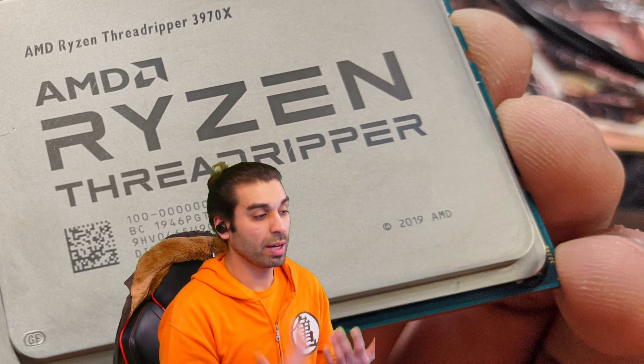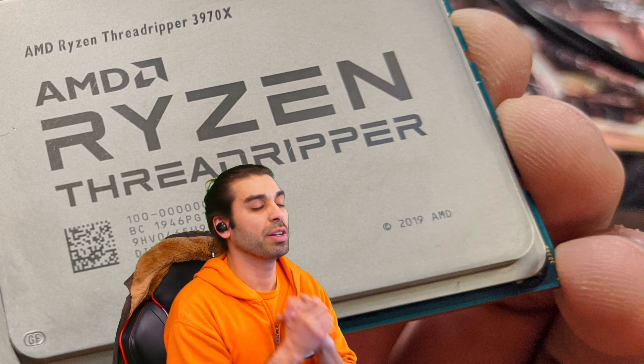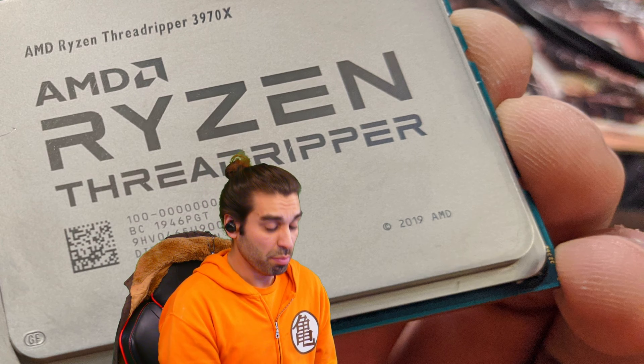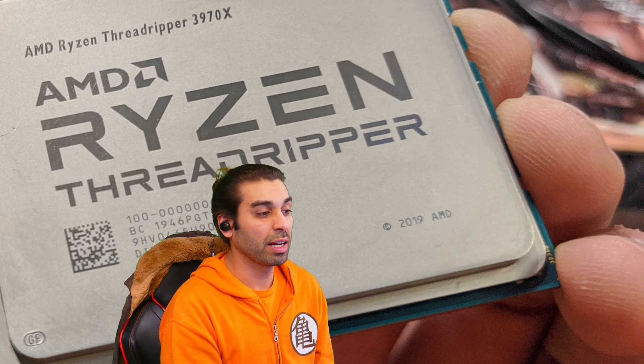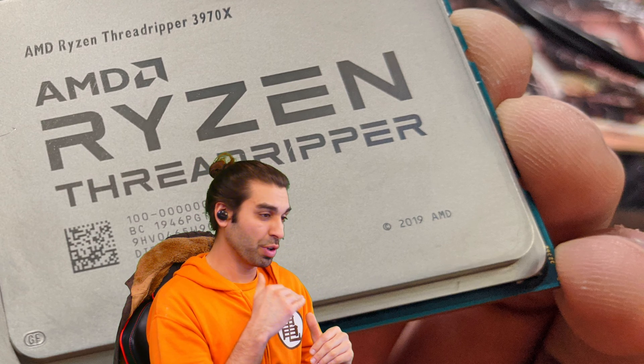It's not really their fault — that's how they do it in a fast manufacturing standpoint. They could rectify this easily by leaving the top, mirror-polishing it, and then laser-imprinting right before, because as they carve it off the markings will still be there and they'd have a very smooth surface. You can see why I had to mill down my beautiful 3970x — to get rid of the pitting. I used the straight bar with light again to measure evenness, and I'm going to be doing an even better mirror-like finish in another installment.